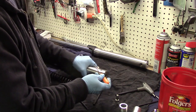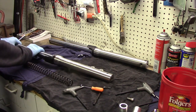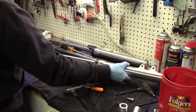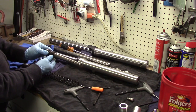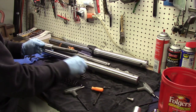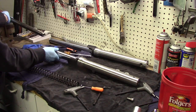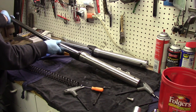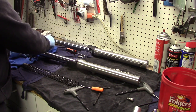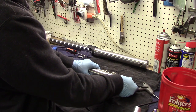If the copper washer does not come out with the bolt you need to make sure you find it — if you miss this, your fork tubes are going to leak. Here I remove the damper rod and remove the spring, then insert the spacer, replace the spring, and slide it in using the damper rod tool to keep it all assembled. Again, use the damper rod tool with the screwdriver in the end while you retighten that allen head bolt.